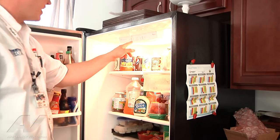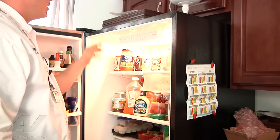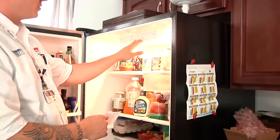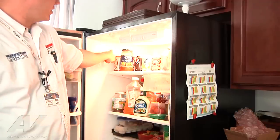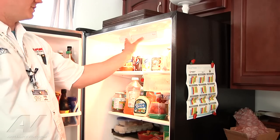You can see it's flashing at us right now. Sometimes it will flash on the display, sometimes it will have numbers. Either way, if you look at the paperwork that comes with it, we have to program this new computer with the refrigerator. To do so, if we look at our model number tag over here, it will tell you what code has to be entered into our new computer.